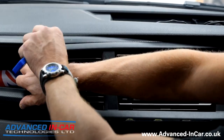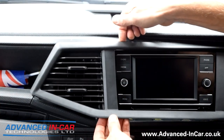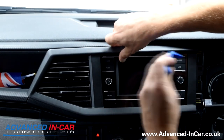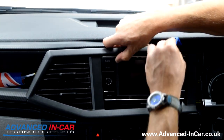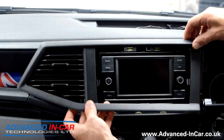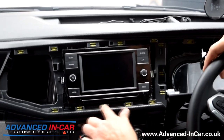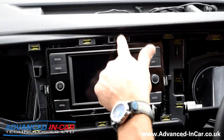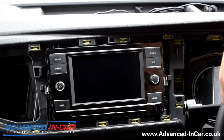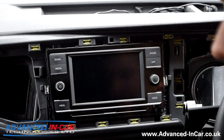Don't forget this dashboard has already been off today because we have fitted the reversing camera. As you get to this bit, this whole panel becomes rather loose. These are the reason why these clips are so difficult to get off - the reason why Volkswagen have done so many is because plastic expands and contracts over heat and starts to squeak and vibrate. That's the reason why they've done this to get a really nice tight fit.